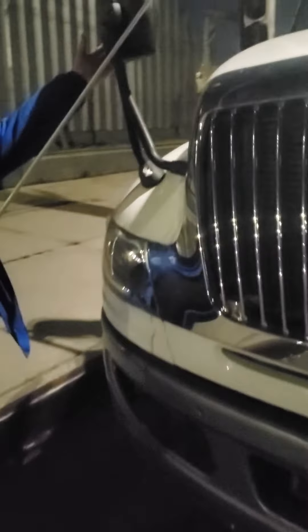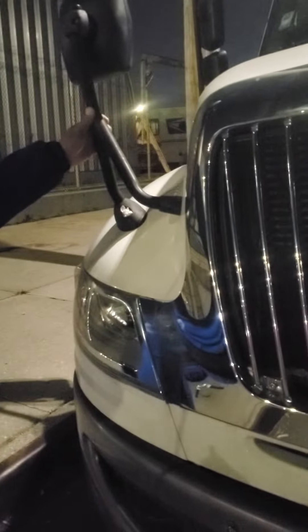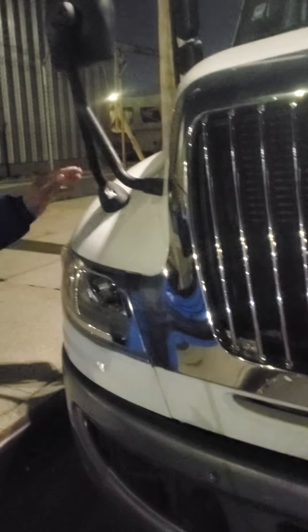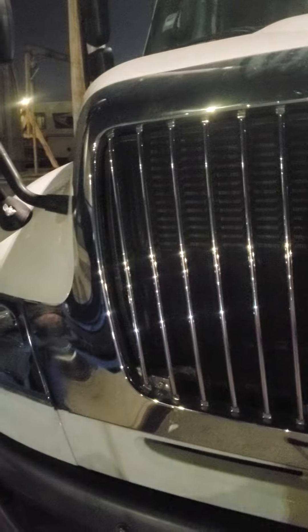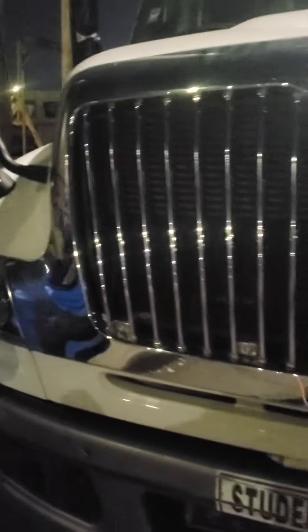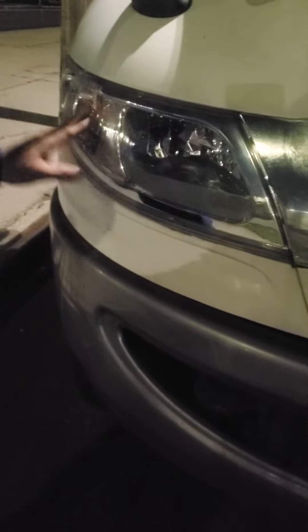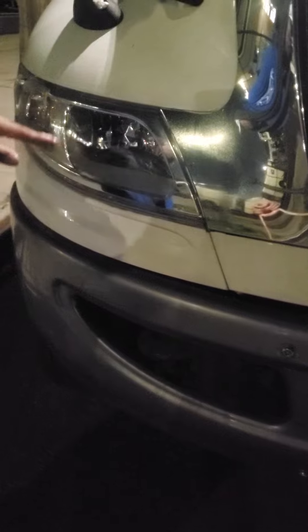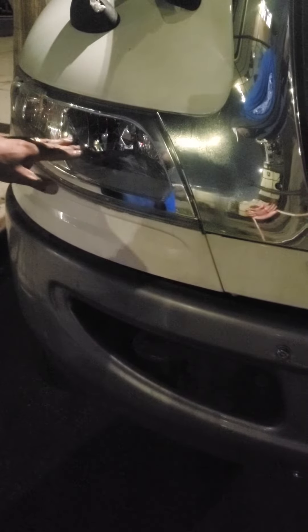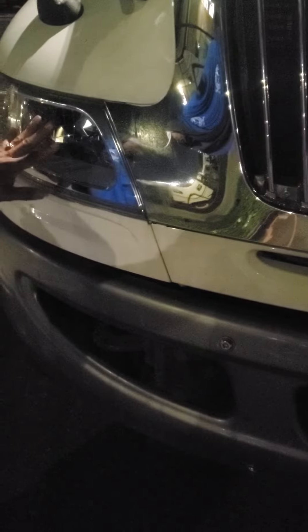Fender, mirrors, and brackets are secure, no crack or broken, not missing bolts, and the glass is clean, no crack or broken. I will check the lights on both sides — marker lights, forward flashers, signals, and headlights low and high beams — secure, no crack, damage, or broken, no fluid or moisture in the lens, and proper color.